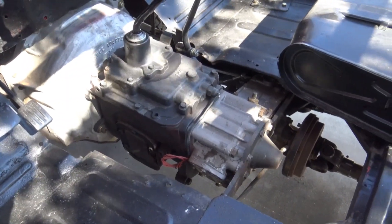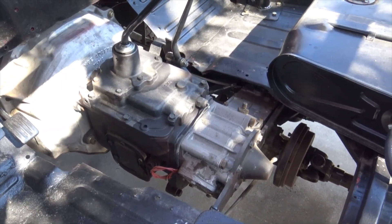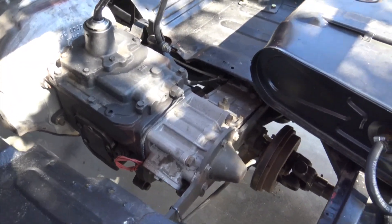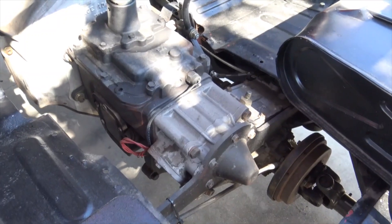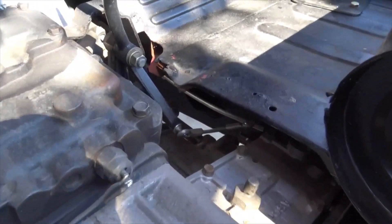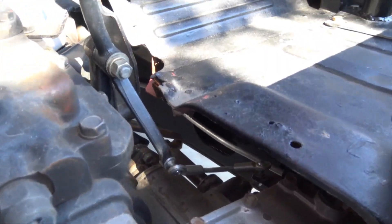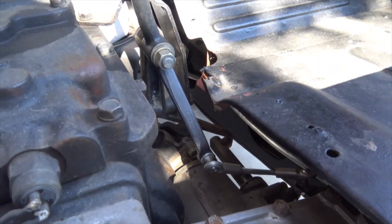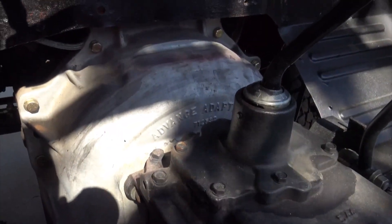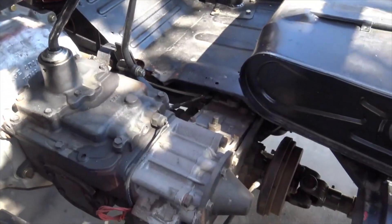Alright, tucking transfer cases. This is the Toyota H42 4-speed which came out in '74, and what I've done here is coupled it to an earlier model transfer case — the 3-speed transfer case. Do a little zoom in here, you can kind of see the U-joint linkage I made there for the high-low, and then you can see this is the Advanced Adapters 4-speed to Chevy 350 conversion kit.